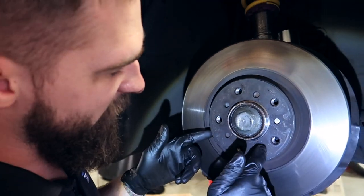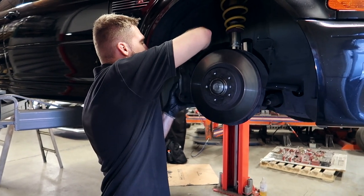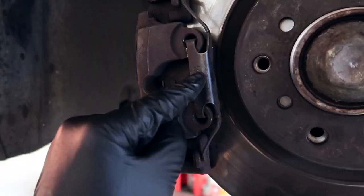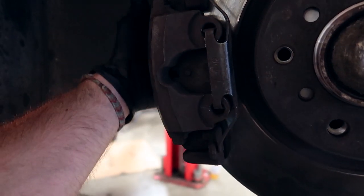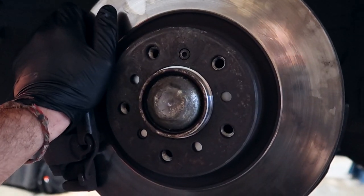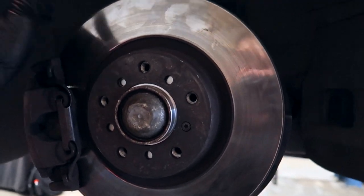Put your rotor back on, take the 5mm Allen key and put the bolts back in. Note: the Timken rotors don't have guiding pins and only have one locking bolt instead of two — I'll keep the one for now. For the caliper, if the piston isn't compressed all the way, remove the clip on the two sides, slide the caliper on, tighten the two 18mm bolts in the back, and put the clip back on. Clean the rotor off with brake cleaner and make sure nothing's wobbling — and it isn't. Put the wheel back on and you're good to go.